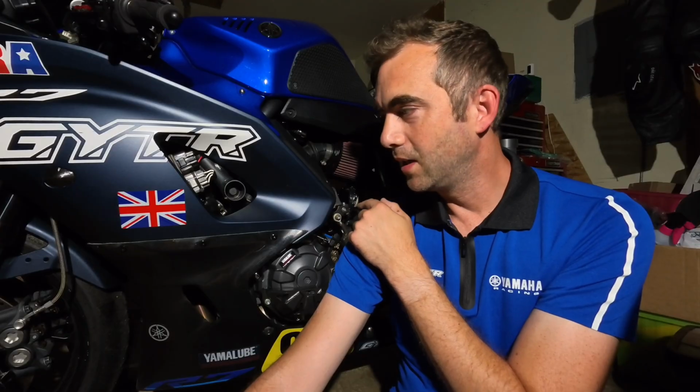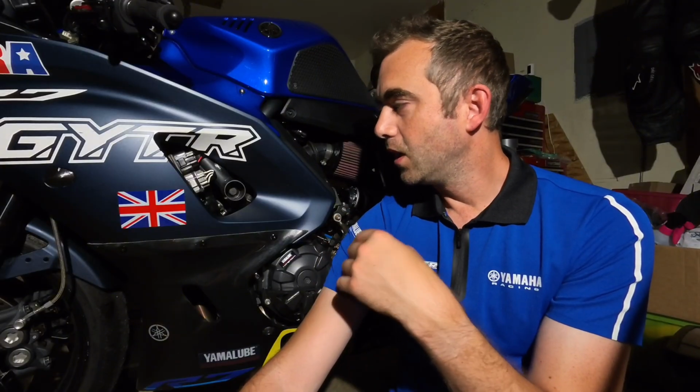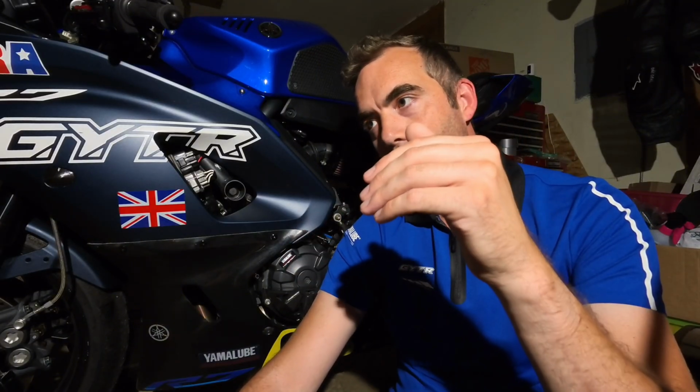So yeah, overall then, where am I feeling with the R7? Well, I'm feeling good. I think there might be the gearing that I'm using now. You can hear it in the video. I only use 5th gear at one point in the whole track, and I'm kind of liking that because 5th gear is notorious on these bikes for just dropping out of gear back into 4th. You have a moment of false neutral or whatever, and there's one particular turn where I was clicking up to 5th with the more teeth gear in the back, right into the kink of the final corner, and it did skip out of gear again right at that moment, which is really off-putting. You don't want that happening.